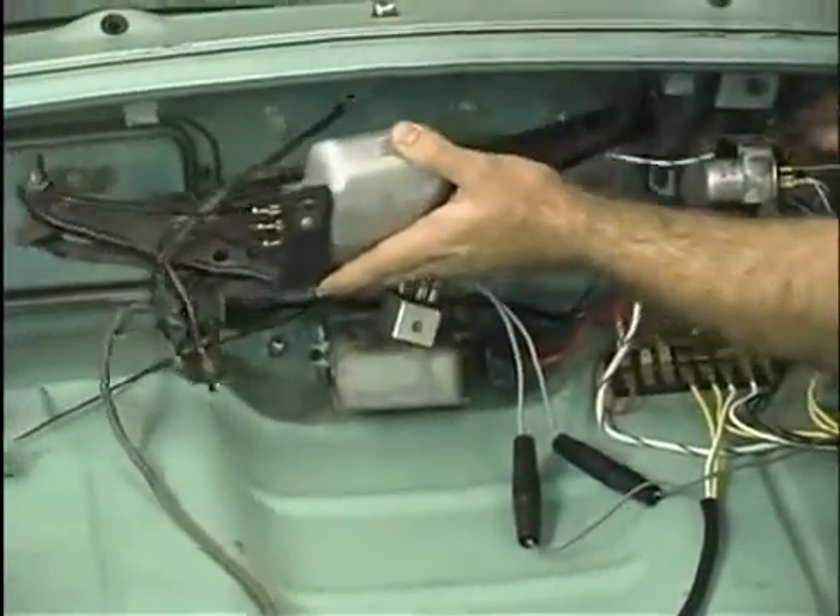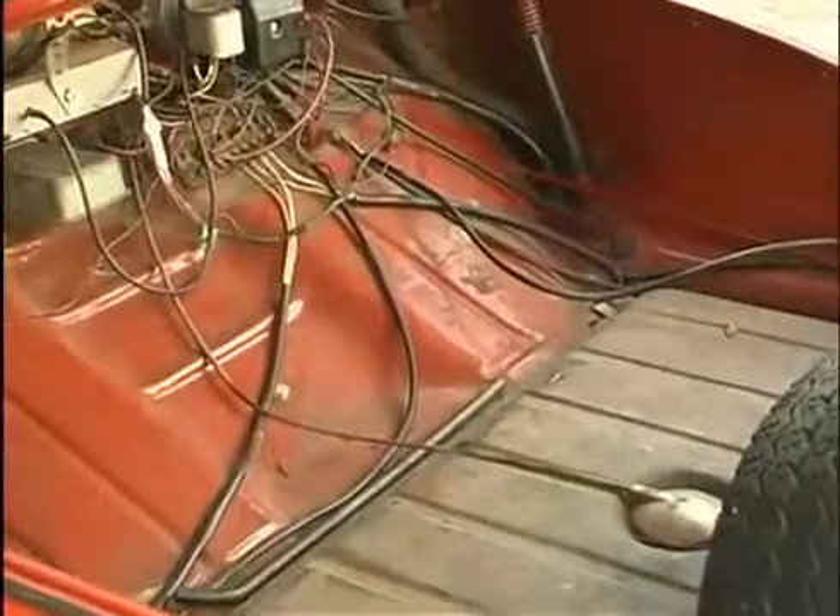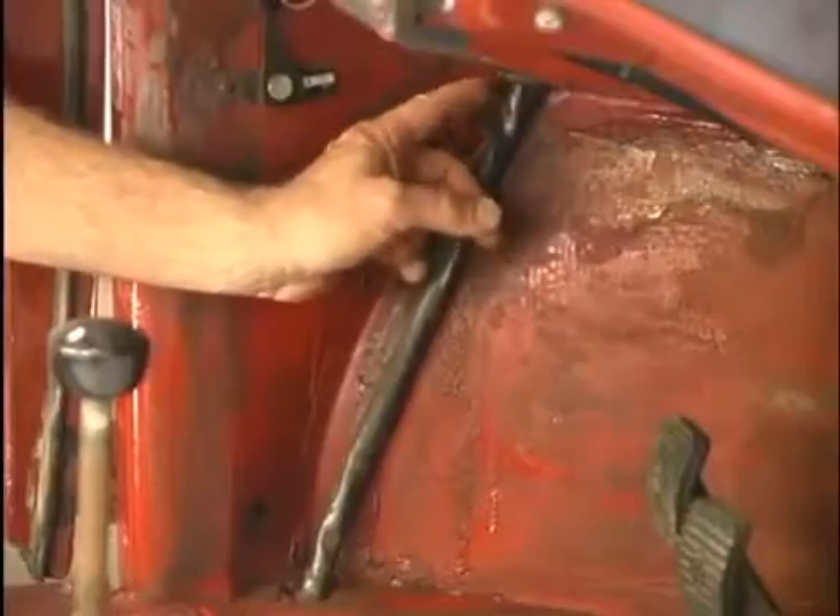In 1963 the Volkswagen wiring was still pretty basic, but in the mid-'60s everybody started becoming a lot more safety conscious, and so there were a lot more changes made in the cars in the '60s — most of them had to do with wiring. We're going to show you some of those changes that might apply to your car. In 1965 they made the windows in the car bigger, which made the window post smaller, so you could no longer run your wiring harness up through the roof. On '65 and later bugs, the wiring harness goes through the floor of the trunk, back in behind the hood spring on the left side, then comes through a rubber grommet at the bottom of the trunk.